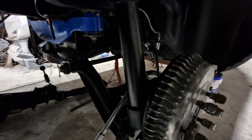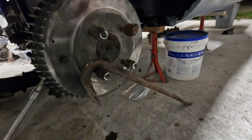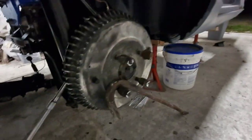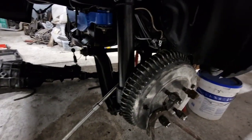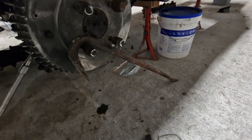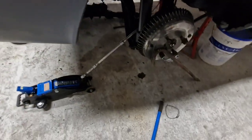To get this bolt open — it's jacked on there nice and tight. I have no drum brake attached, no wheel. So what I'm going to do is use a couple of laws of levers. I've put a crowbar in here and I have a jack on this side. I'm going to jack that up until the car starts to lift, then get down here and try to pull that off and get the bolt to break free. Let's give it a shot.